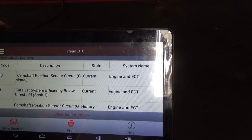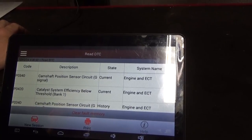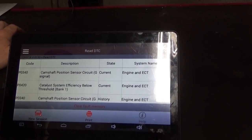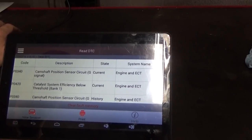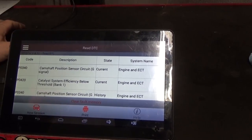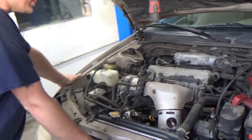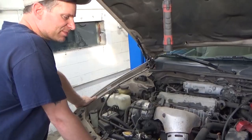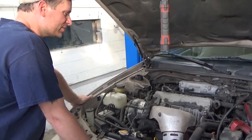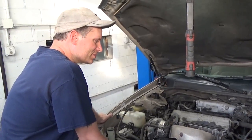Now what we could do is monitor a few things and hook up the oscilloscope and do a couple of different tests. However, what if you don't have this equipment? So we're going to stop there knowing that we have a camshaft position sensor code and the sound of this engine while it's cranking, and see if we can base our troubleshooting just off of that. Let's just start pulling stuff apart and pull the timing cover off, but how about we just do a simple compression check?